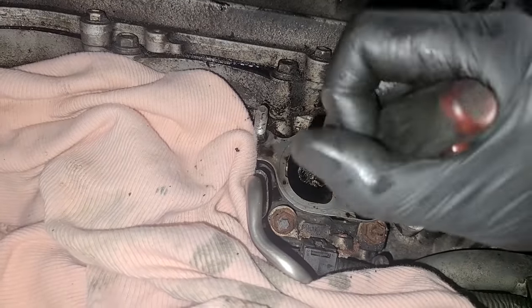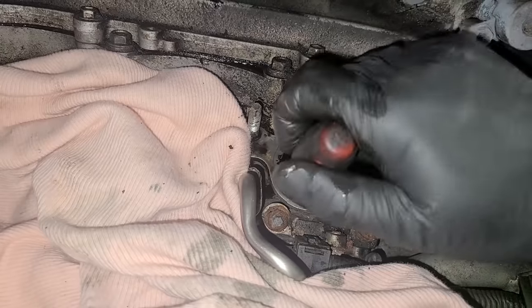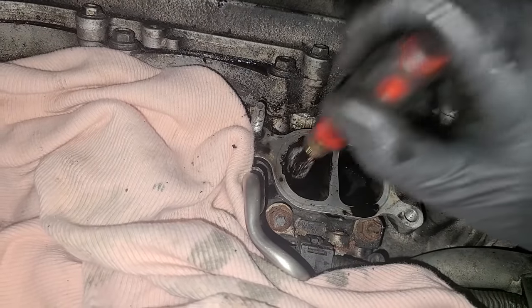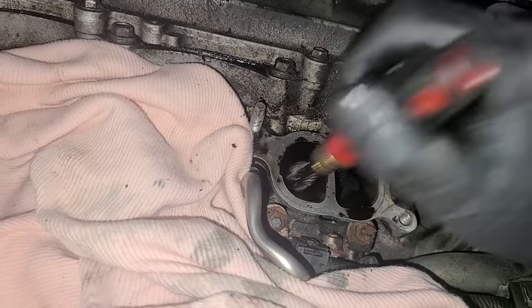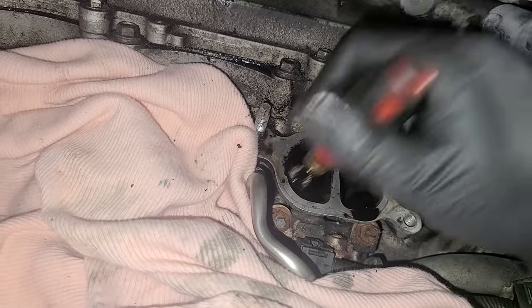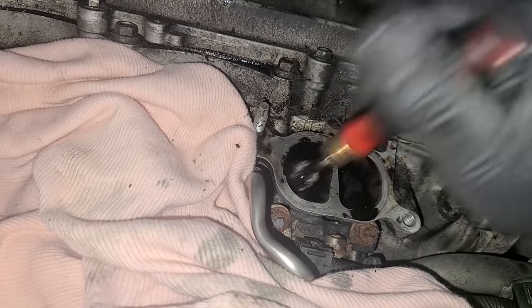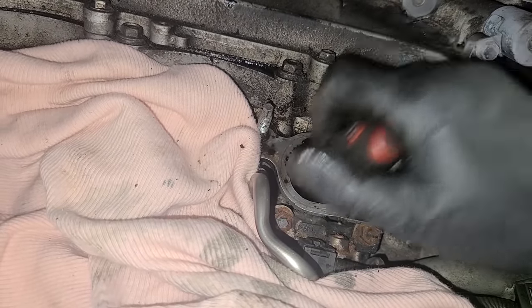So we're mostly doing this to clean the inside wall of the chamber. So we're not really touching the valve just yet, but we're just cleaning up around it. And with this tool, you're not supposed to use a drill because these will shred apart. So this is all done by hand. And really you don't need a drill if you've let this cleaner soak in there. This carbon gets pretty mushy and is actually pretty easy to remove.